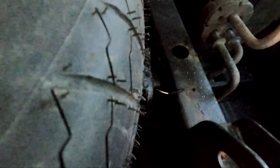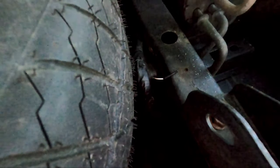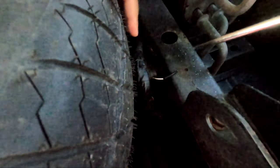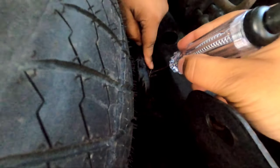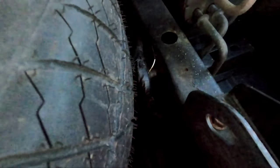In case anybody's wondering, it's a white wire with a purple stripe on it. When you follow the wire harness on the driver's side near where the spare is, you'll see one standalone wire just hanging out by itself. And bam — that's the brake signal confirmed. So now what I'm going to do is extend this wire and run it to the brake connection on the frame. I really thought this was going to be a failed project, but no.